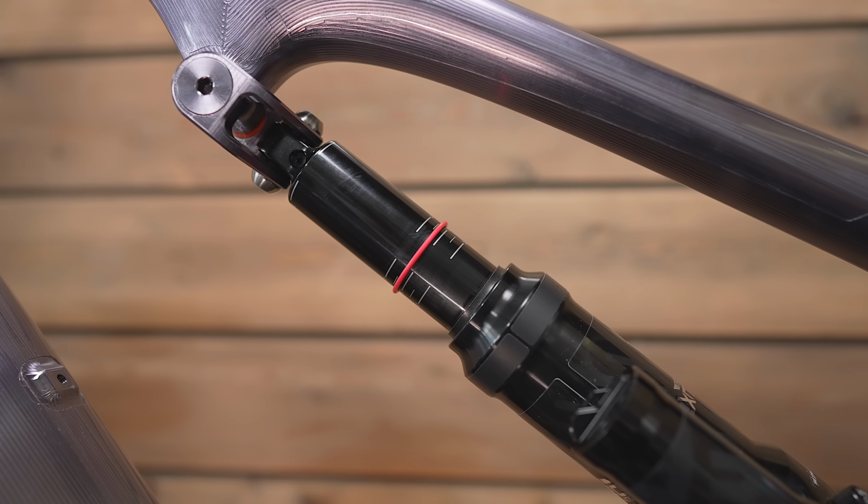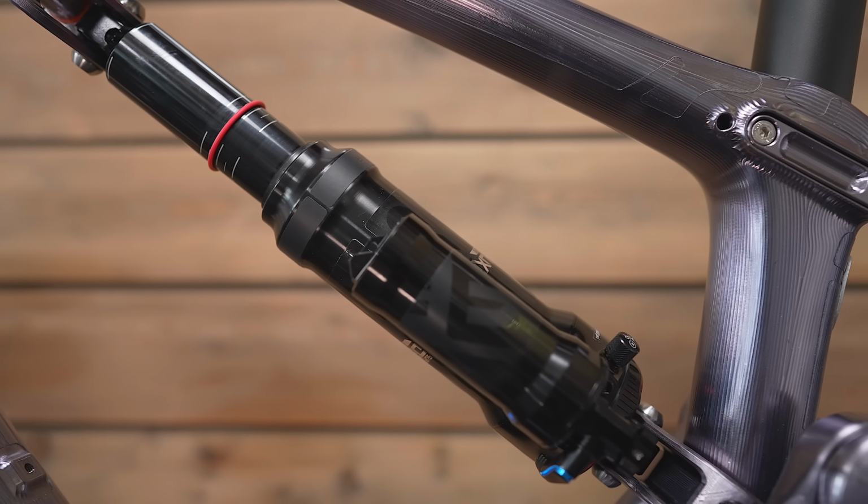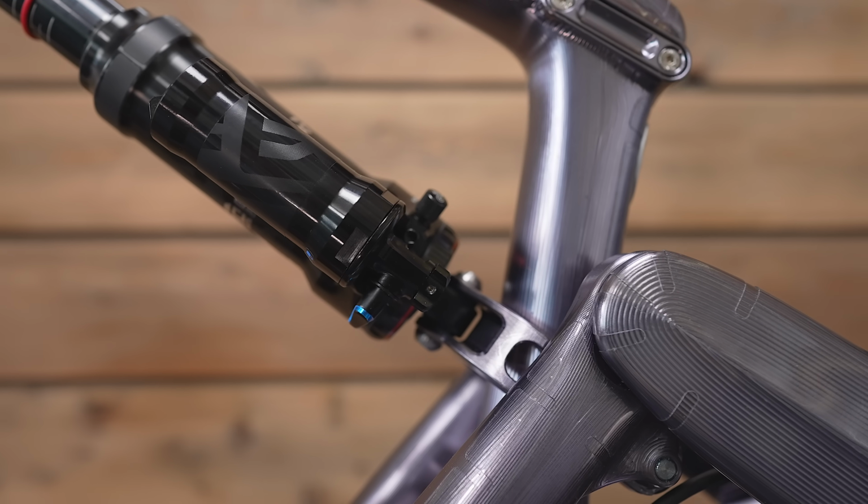Reading through the user manual, most user manuals are just all focused on safety and to stop the company from getting sued, really. That's important because safety is important, and there's some stuff in here on safety, but there's a load on suspension setup, and it talks in a language that you can understand and appreciate. It's not just saying set the fork to 20% sag, set the shock to 30% sag. It explains what you're doing and why you're doing it, and if you go less or more, and if you change the compression damping, it explains the effect that you might feel. And it feels really personal. It feels like someone wants you to get the best experience from the bike. And there's 4 or 5 pages or so on how to set up your suspension, which is probably more than I've ever seen, other than just a token paragraph in most bike user manuals.